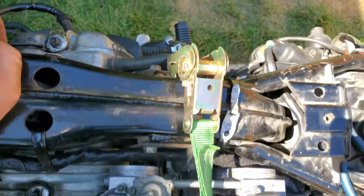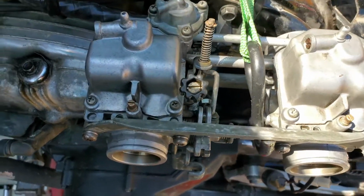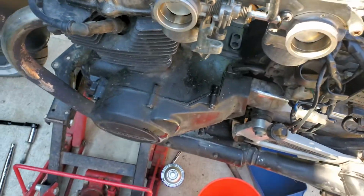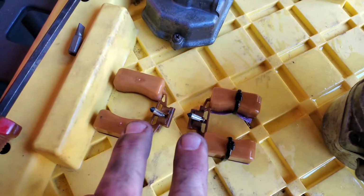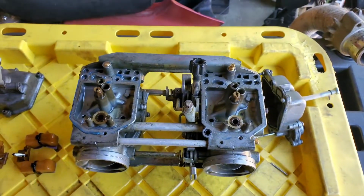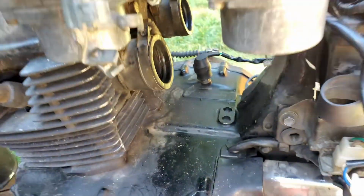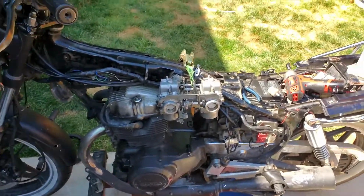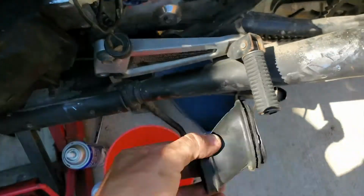We've just strapped the carburetors here upside down, and I'm going to very carefully remove the float bowls and the floats and replace them, as mentioned, with these two guys here from the old carbs, or the second set of carbs that are all sorts of messed up. In the end, I probably removed the carbs and reinstalled them a half dozen times, so at least I have even more experience doing that than I ever did before.